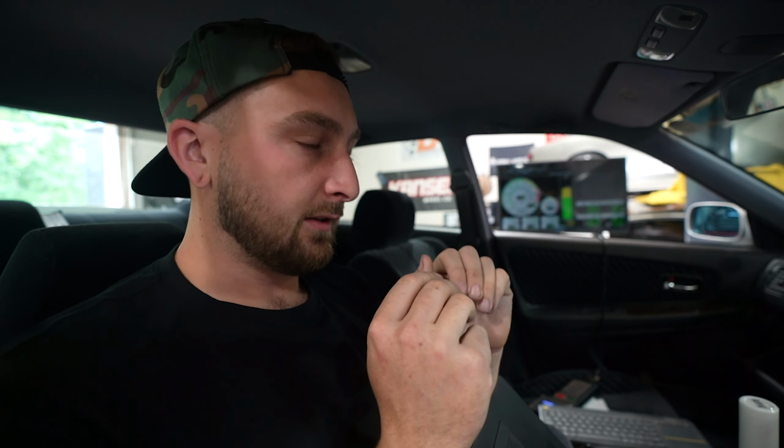You guys have seen me tune a lot of cars. Since this is the first time really getting into it, we're gonna try to do a couple tip-in pulls, where I get into the RPMs, let boost build a little bit, and see how the fuel table, the VE table, whatever you want to consider it, wants to look. Because every car is different. So I'm gonna build a rough map with numbers that are safe enough to complete a full pull. We'll do pulls, change timing, change fueling, change boost, and eventually we'll come to a good map. It's the broadest way of putting it.